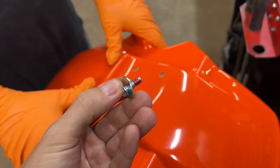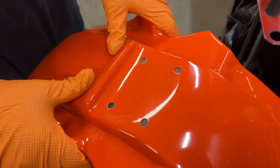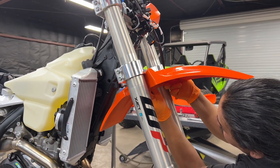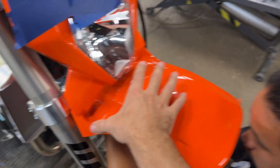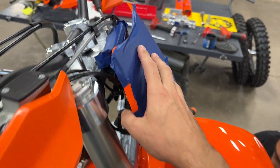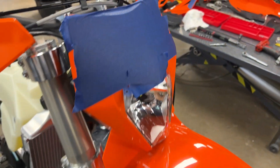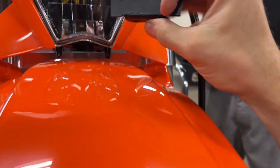When you go to install your front fender, make sure you use that fender washer along with some red Loctite. We've got some holes drilled in here. I've already gone ahead and rested the headlight on here — I'm going to show you the next step to getting this mounted to the wide front fender. You'll notice blue tape on a lot of these clips because we try to protect them as much as possible. It's easy to scuff or scratch them, especially the speedometer. Looking killer — this is going to be a sick build. Once again, a bracket solves everything.